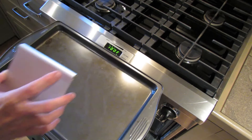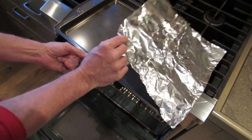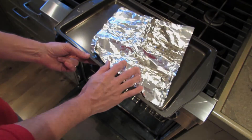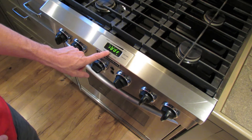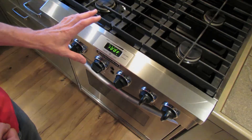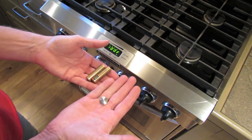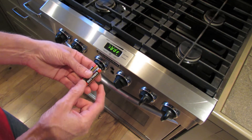I got a cookie sheet, placed the trackpad on it, then took a piece of tinfoil and put it over top. I put it in the oven and left it on a hundred degrees Fahrenheit for eight hours to give it plenty of time to dry right out. I then popped the batteries back in, put the cap on, and I've now been using it for about six weeks without an issue.